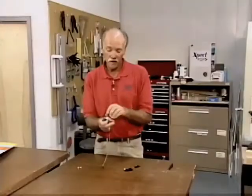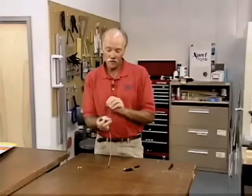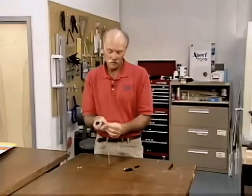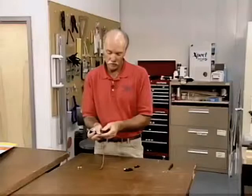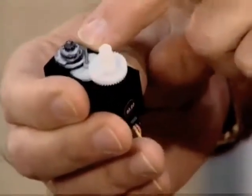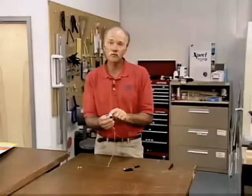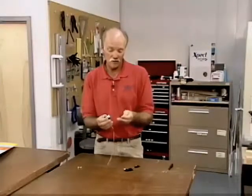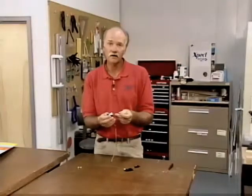Check for any broken teeth. If you have broken teeth, odds are those teeth are going to be stuck in the lubricant you see on these gears — there's a white silicone-type lubricant. There's quite a bit on the main gear that goes from the motor through the train, and broken teeth are likely to be in that lubricant somewhere.